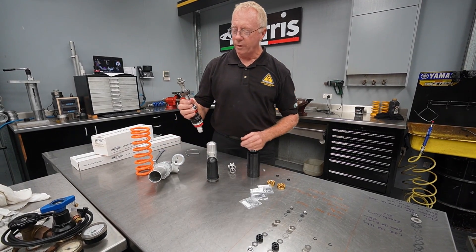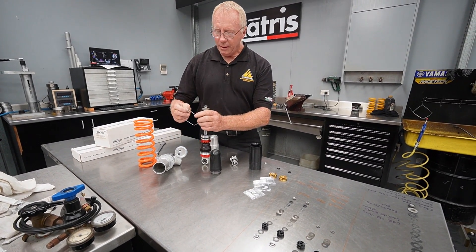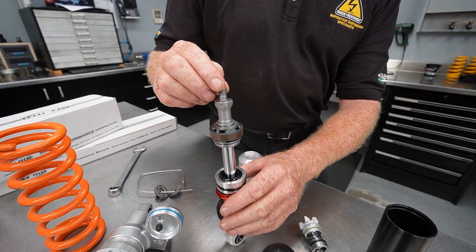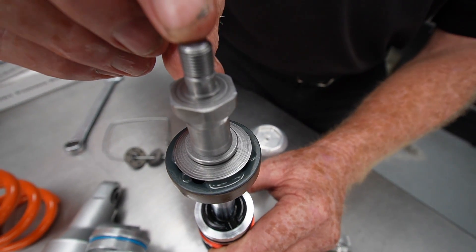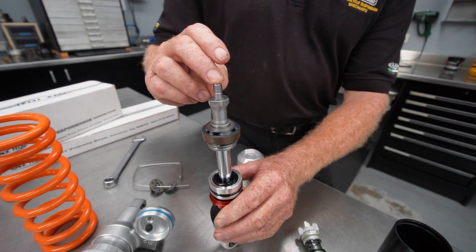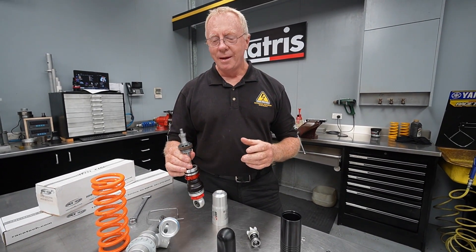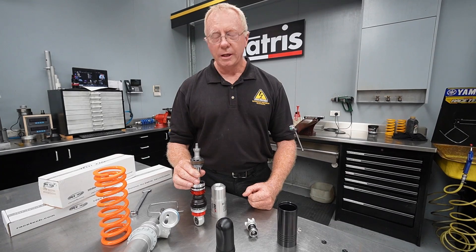Now with the rebound on this shock, as I said, it's very very slow. I've deliberately loosened it so we can have a look at the additional rebound arrangement in here. I'm going to wind this off and pop this valving off. What we have is a rebound separation valve of sorts, and this valving here is in permanent operation — there is no bleed or float on it — so what we find is we get an excess of rebound damping. The only bleed we've got here is a very tiny one millimeter bleed on the side of the shock shaft, and that will flow in both directions — both on rebound and compression.